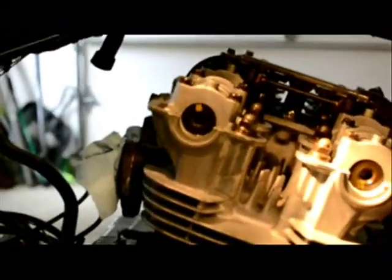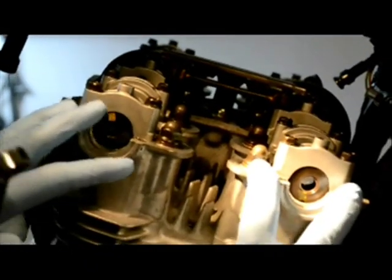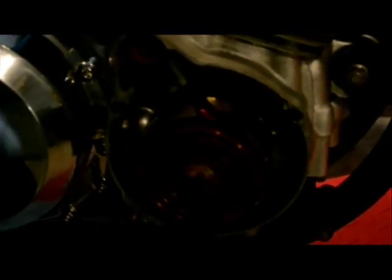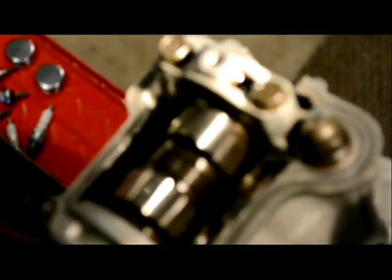I assume you can follow the manual to remove the tank and everything to get down to this point. I've removed the valve cover off the top, which exposed both camshafts. This is a dual overhead cam CB 900 — same for a CB 1000 and CB 750, mostly mid-70s to early 80s. I've also removed the alternator cover; there's a gasket on there you'll probably need to replace. This is where you turn the engine for each position. The exhaust cam is the one that matters — right now it's at six o'clock, and positions follow A, B, C, D per the Clymer's manual.